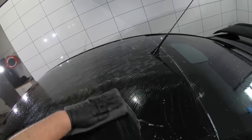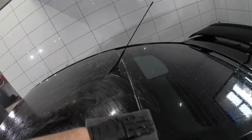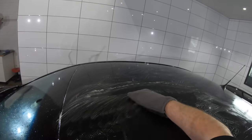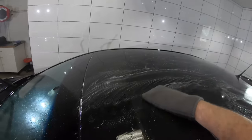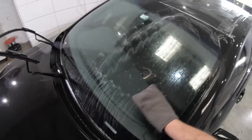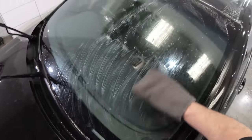The other thing is that using these chemicals over dirty car paint never allows them to work as effectively because there's a layer of looser dirt and grime between them and your chemicals. But once you remove that looser dirt with a pre-foam rinse and hand wash, the chemicals can then be applied directly onto that more stubborn contamination and even wiped into the paint and trims to increase their effectiveness, which is something you certainly shouldn't do without first hand washing the vehicle.